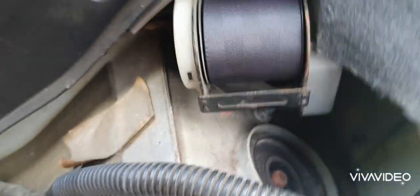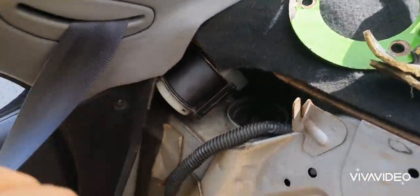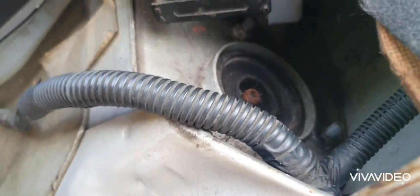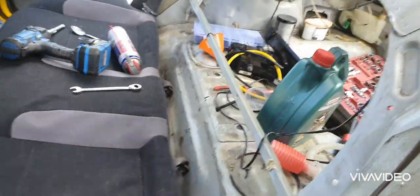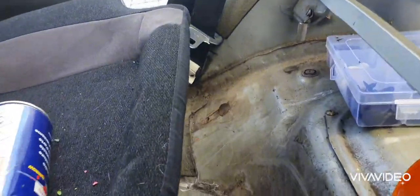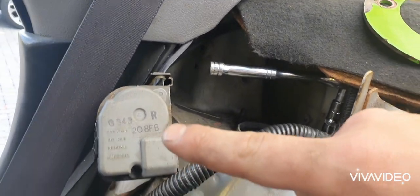I've figured out how to get the rear strut brace on. What we're going to do is remove the seat belt, which is just here — there's a bolt hidden in behind there. Then we've got three bolts on top. I think we're going to mount this bracket on first, then probably mount the bar which goes underneath the rear parcel shelf. I made things easier by just removing the rear seats altogether, just to get plenty of access to the strut tops. The rear seats come out with a 14mm bolt — there are a few of them. We've also removed this seatbelt tensioner, and we're in the process of removing the top mount bolts. Because they haven't been off in a while, they're a bit sticky.